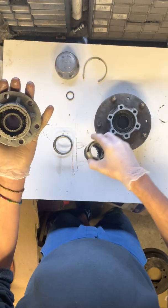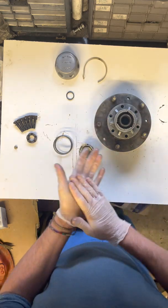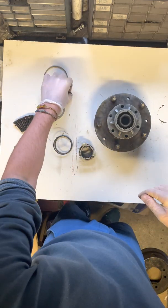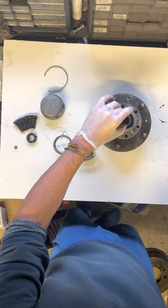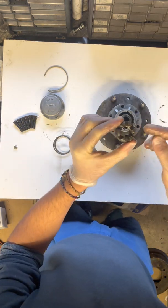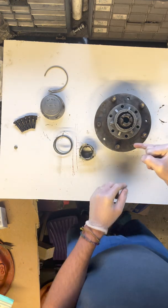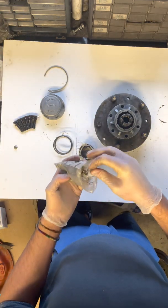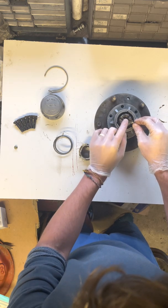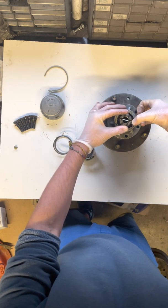So if I just place that on there roughly for now — you've got your hubcap here, you've got your nylon thread. You've got this, which is basically a little washer, that fits in there. And what happens against that lock — this would be another lock-in nut, and this locks the assembly onto the half shaft. And then you would have a pin — I'll just use a rivet for now. The pin would go through that and it's normally bent. In the actual end of the half shaft there's a little hole, and you'd have a pin going through here just to lock this nut in place and lock everything together.